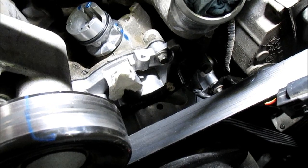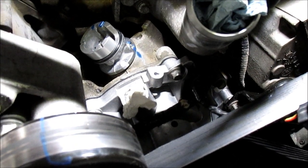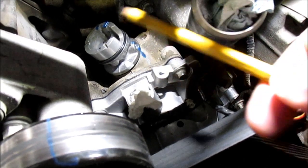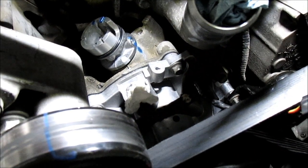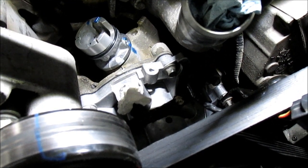I also had a white paint mark that lines up with the parting line on the timing cover casting — a little less accurate, but I think it's in the right spot. Everything lined up, so I'm going to put the hold-down bolt in with the big washer in that hole back there, and before I give the final torque I'll double check it one more time.